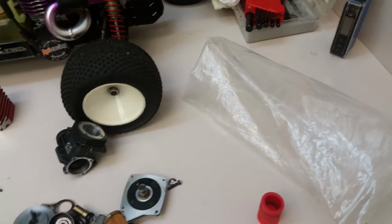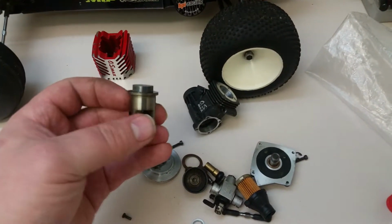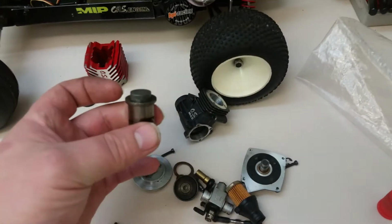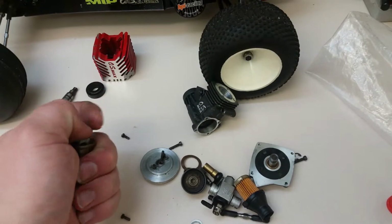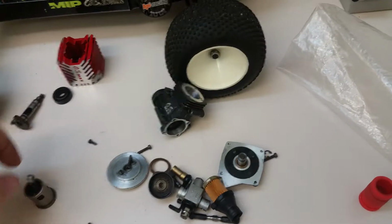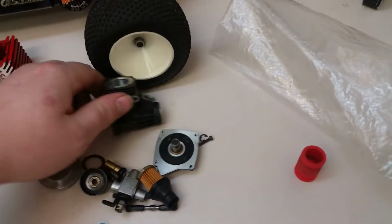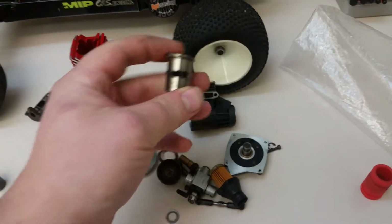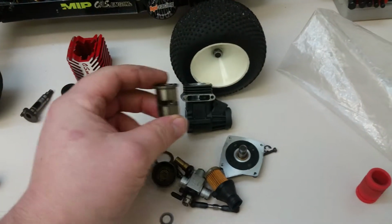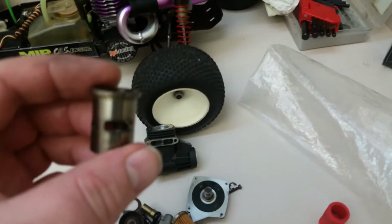And what they did, well, here's a piston sleeve. Obviously, you can see it's completely destroyed. Like, it's not supposed to come up that far. Ever. So, when I got it, obviously most of you know, that's the exhaust port. That big kind of rectangular port. That's supposed to face directly in there. Well, if you look...